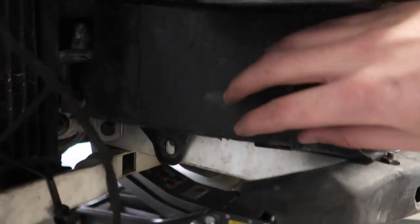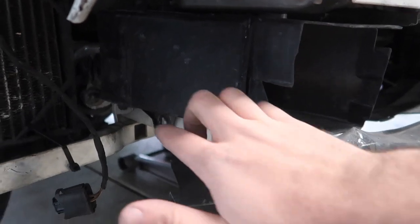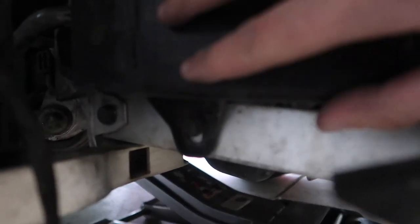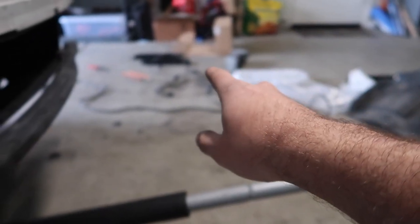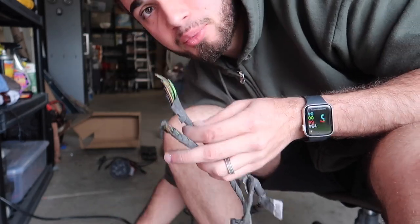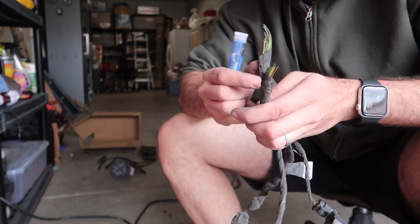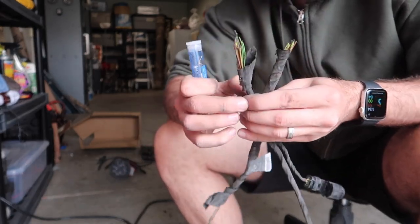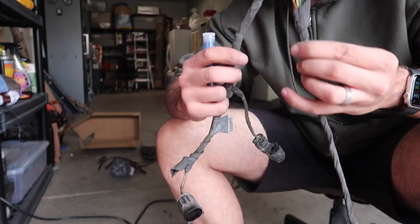I'm just going to go ahead and leave that new sensor in and hope for the best. It looks like we can support this bracket and little air duct by putting a screw down there, so let's make sure this actually stays in place. I went ahead and plugged in the fog light connector. New sensor is in, screw is holding everything in place - bada bing bada bang. The next thing I want to do is fix the PDC sensor. I have heat shrink tubes and solder, so let's strip these down, solder them together, and use heat shrink for a permanent fix so our PDC sensors finally work.